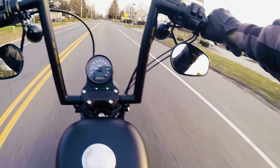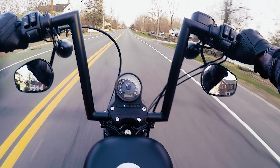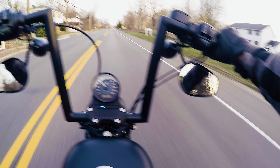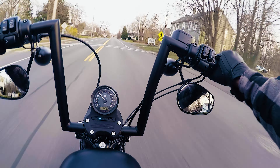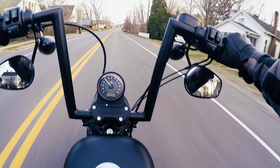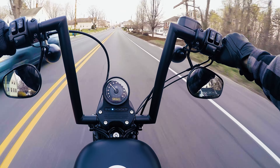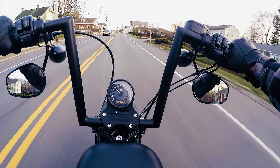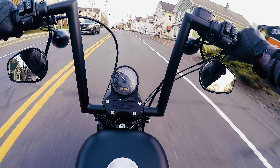I know there's not a whole lot of info out there about the Todd Cycle strip bars, especially in regards to a Sportster, so feel free to leave a comment below — I'm happy to answer any questions you have: measurements, diameter. These are the one-and-a-quarter-inch strip bars with the knurling. I would highly recommend that for any bars this tall so they don't slip in the clamp and the triple tree. Feel free to leave me a question and I'll answer it within a day or so.